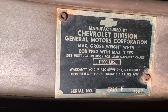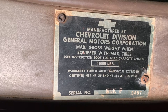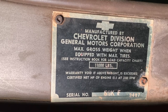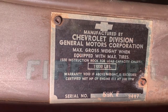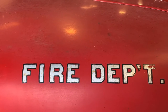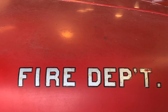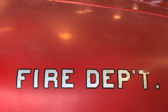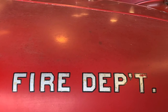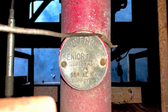The truck was actually dragged on a trailer and off a trailer by the Vintage Fire Museum to get it into their storage annex. So before we did anything else, I wanted to tackle the brakes first, get the chassis at least rolling so it could be moved around and worked on. We ensured the parking brake cable and levers were released, that there was slack all the way up to the adjusters at the backing plate. This brake setup did not have access to the slack adjusters, although as of this time we still have not got the drums off, but they do roll now.